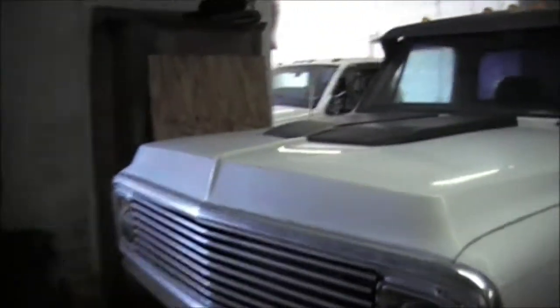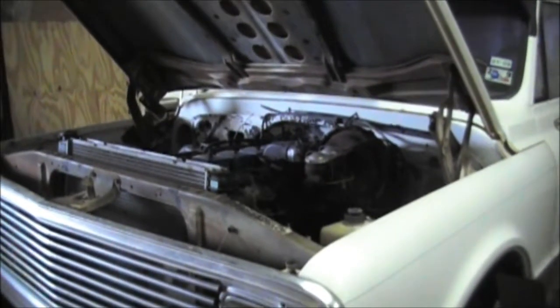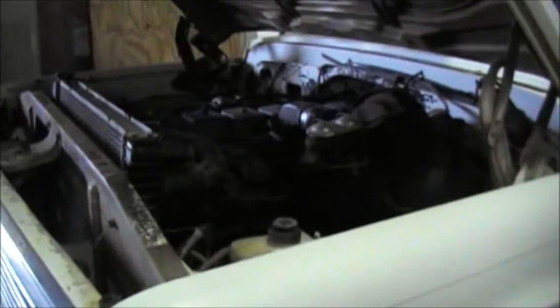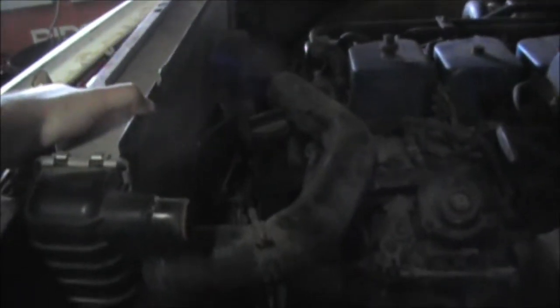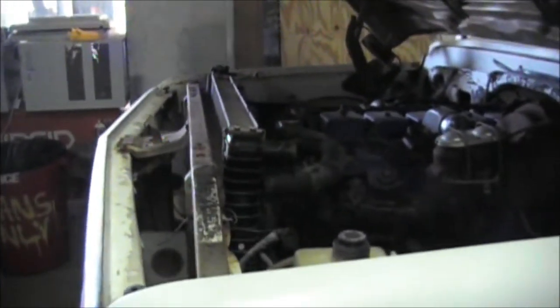I'm going to pop the hood here real quick and show you all how the Cummins fits. Keep in mind this is the first time this hood has been on the truck in about two and a half years. I didn't have it when I was making any of the measurements for the Cummins — I just had to work off of what I knew, dimensions I could get. And as you can see in here, we've got plenty of room. When you push the radiator forward all the way, there's about a half inch at the top there. This fan isn't going to be run — I'm going to be running a narrower fan, actually a set of twin electrics. This radiator is the old one out of my 85 Chevy. I'm going to run it because it's a little bit taller — it'll give me just a little bit extra cooling power. I'm going to modify the core support here a little bit to get some airflow and build some custom brackets that will pull it up over the top. That should keep air flowing through that thing all day long and help keep this puppy cool — it'll hold just a little bit more water too.